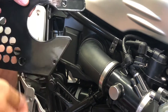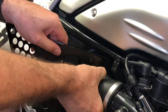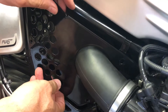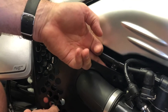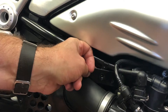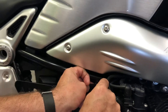The first thing I need to do is put the panel onto the bike. I do that by compressing the air intake tube and loosely positioning the panel there. The next thing I need to do is get behind the clamp using a finger to line up the panel and the clamp, and then insert the fastener.